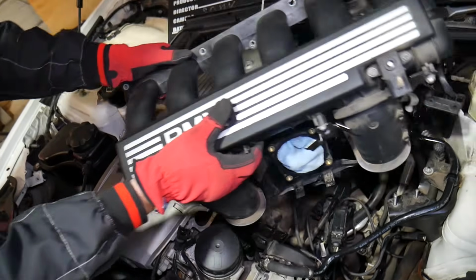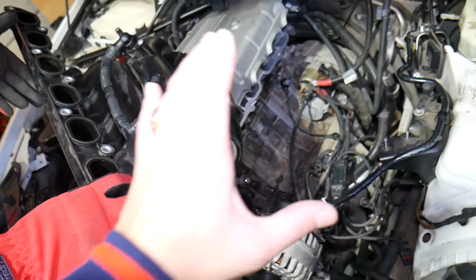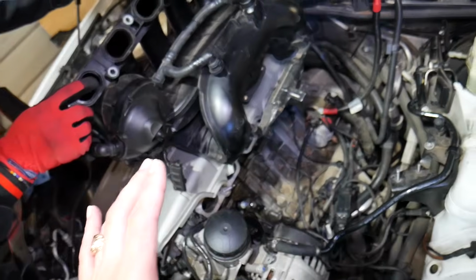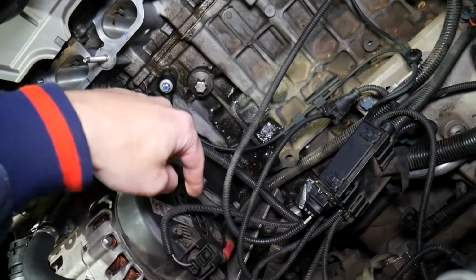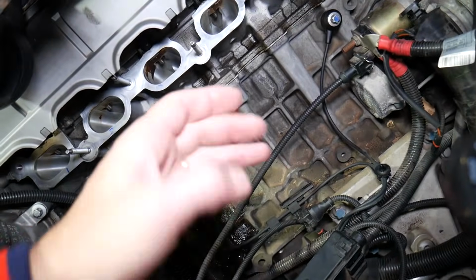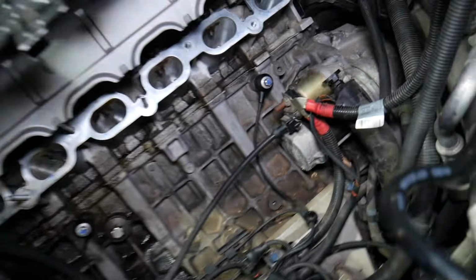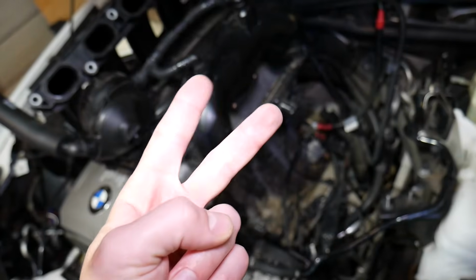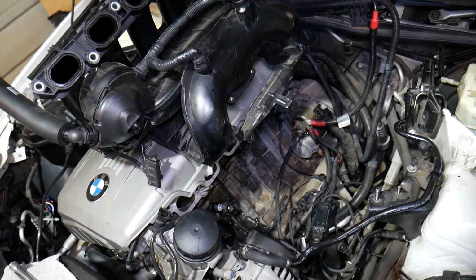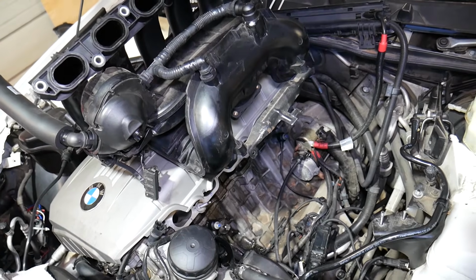So once you open the hood, we have the intake manifold removed here. If you want to see the video, everything is on the channel. Now when you remove the intake manifold, it's super important to disconnect your car battery, because you have the engine starter and the alternator wires here, and if you touch them you can short things out, burn the electronics, and cause quite a bit of damage. And on modern vehicles it really matters which battery terminal you disconnect first, positive or negative. So check it out. We'll have the video in the description below, and we'll share the link so it explains all that.